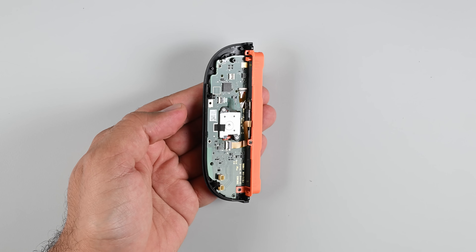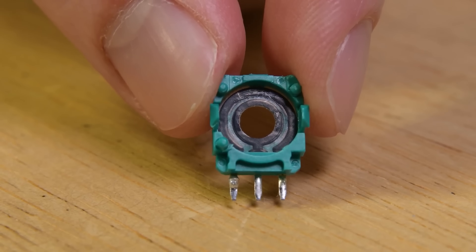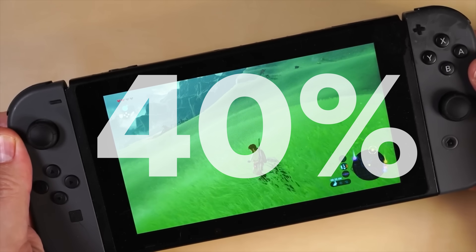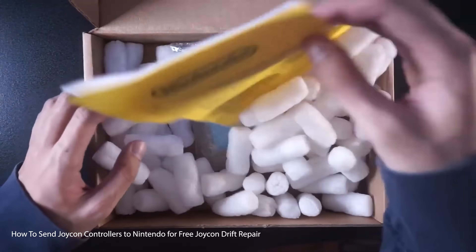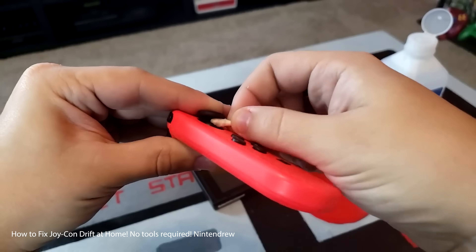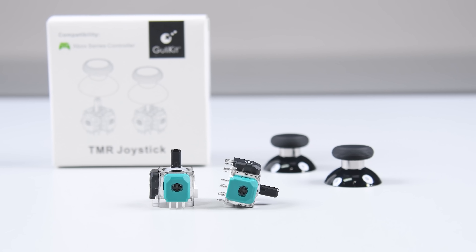Next I'm setting my sights on the sticks. Old Joy-Con joysticks use a potentiometer to read the voltage at a wiper that slides across a strip of resistive material. That material wears down over time, or plastic and dust can dirty the sensors. Stick drift has been a huge problem — one survey found 40% of Switch owners had problems with Joy-Con drift, and things didn't improve with the Lite or OLED editions. After lawsuits, Nintendo's president apologized and set up a free repair program. The best fix is replacing them with drift-resistant tech using magnets instead of potentiometers, such as Hall Effect or tunneling magneto-resistant (TMR) sensors.